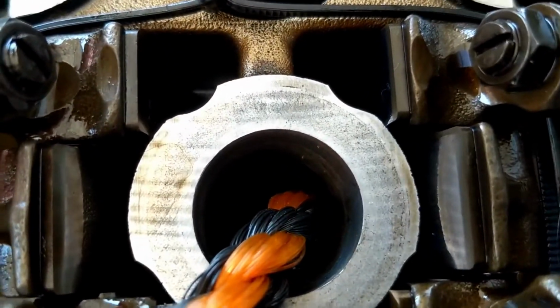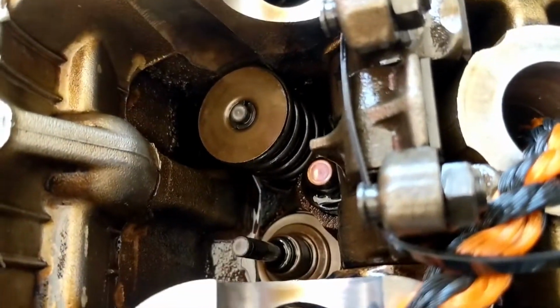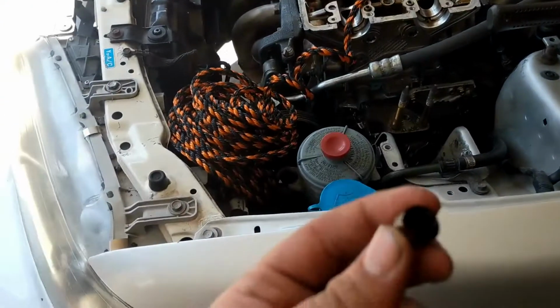If we look in there, the rope's in there now, but you can actually see oil on the piston. We left for lunch and came back an hour later, and there was actually a coat of oil on the piston. So that definitely leads more towards this leaking, because that's the only thing gravity feeding oil right now. You could just run a Subaru one.